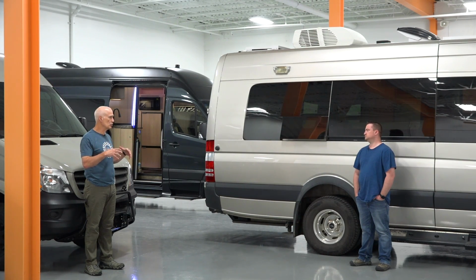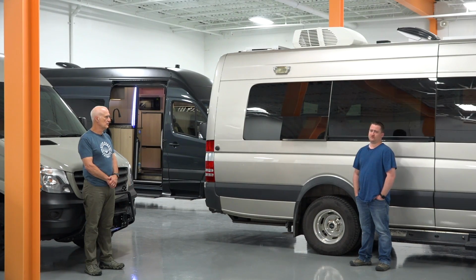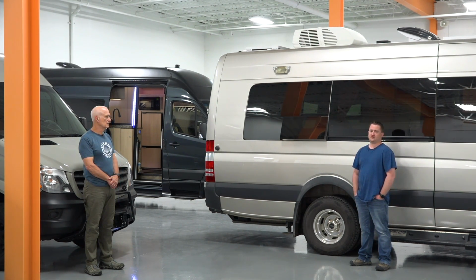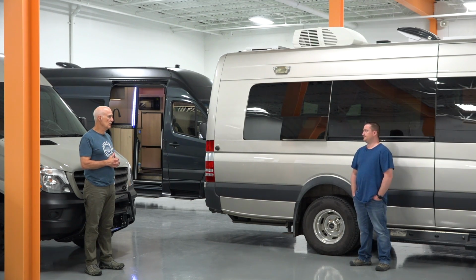And then the third thing, maybe Mike, you want to talk about is window protection from UV mostly and other radiated heat. Starting with the regular tint. So a regular tint by nature is about 98% UV protective, which is good. It works well, but it doesn't have a good heat reflection to it. It's about 22% roughly. The film that we currently use is a ceramic film. There's also carbon films, which are one and the same. The ceramic film has about a 49% total solar energy reflection rating, which is what the rating is for heat reflection. And the darker the film is, the slightly higher the number will go. And it too is also 99% UV protective. So it protects anything inside from fading and UV deterioration. But from a heat standpoint, it's about 50% reflective of the solar heat. Just about, yep. And maybe a little more or a little less than that.